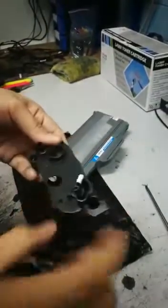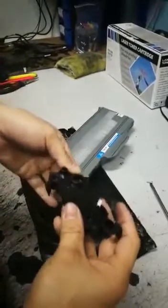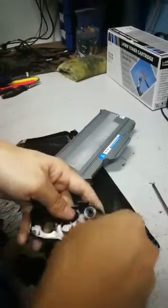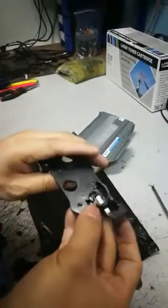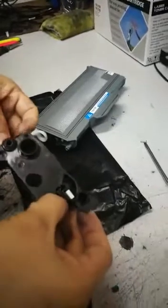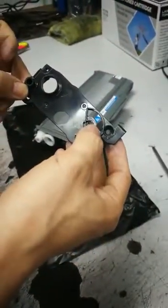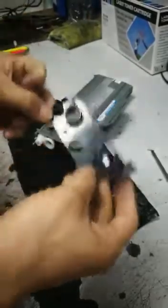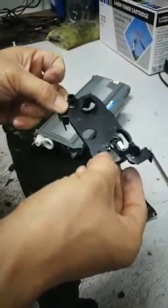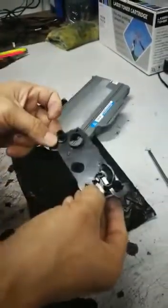The correct position should be on the left, as I'm showing you right now. Once the toner has been inserted into the printer, it will be triggered and moved to the right by the printer. So if you try to insert a toner with the sensor on the right into a printer that has detected low toner, it won't be able to detect it.